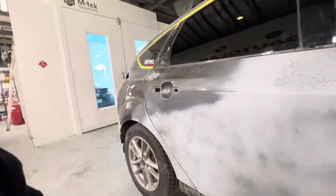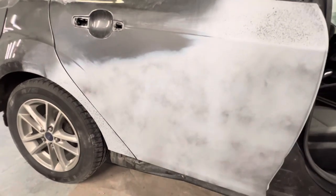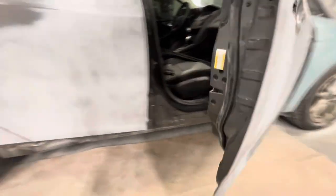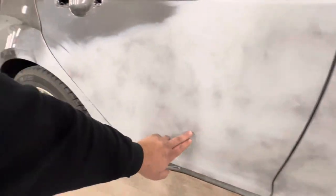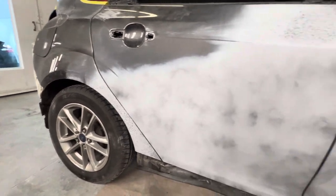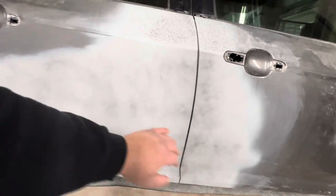You can see here I have a couple of different guide coat sections. I did have to body work this rear door a couple of times. The first time, my body line kind of disappeared, so unfortunately I had to open it back up for body work and get it re-bodied. I reprimed it yesterday and it came out awesome. We'll snap a nice line with some masking tape and prep this thing out with a longboard with 220 to get it ready for paint.